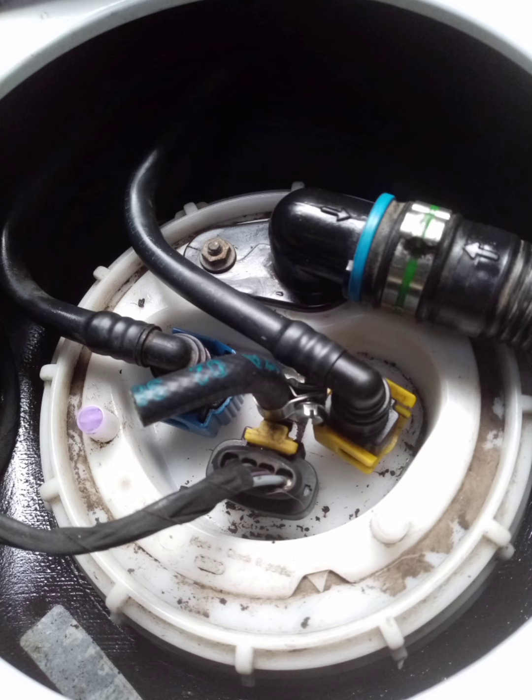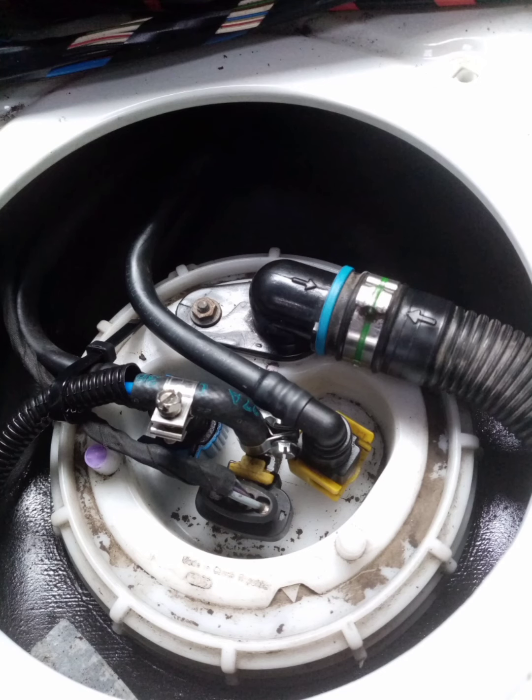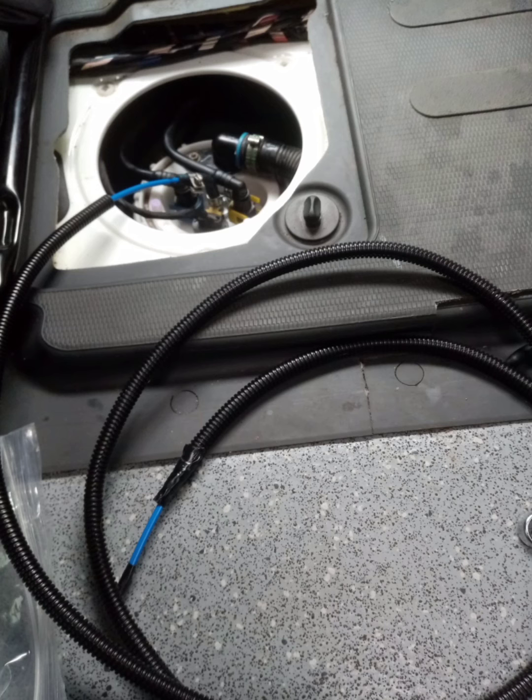Fit the right-angled rubber black hose along with a jubilee clip onto the metal pipe and tighten. Using your 4mm external blue pipe, connect that into the black pipe and tighten with a jubilee clip. It's normally about 2 metres long — the distance between the outlet at the fuel sender unit to your diesel heater fuel pump.